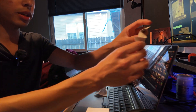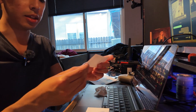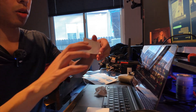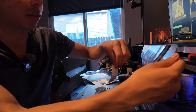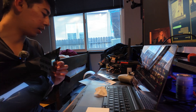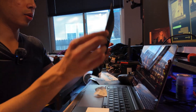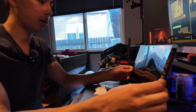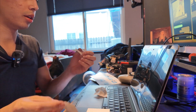From there, step two is to wipe the screen with our microfiber towel. Step three is to take the dust absorber and just go around the screen a few times removing any dust. Then we're going to take the screen protector out of the package — it says tab two or front, so that side is going to be facing forward.